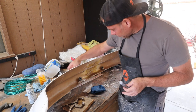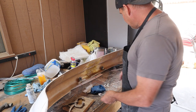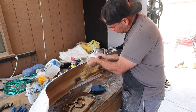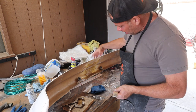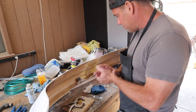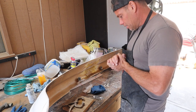I still have to cut the mouth for the air duct and reinforce it. I'll probably take something like a stir stick and put it here on the bottom and glass that in, so that's going to make this lip reinforced when I cut the middle section out for the air intake. But we'll get to all that when the time comes — I just want the thing mounted so that I can sand it and do the bodywork on it and paint the car.